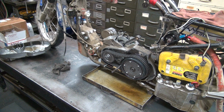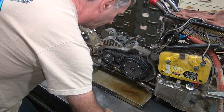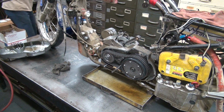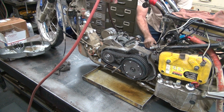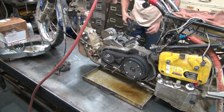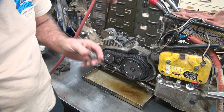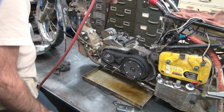So I started using a lock tab just enough so it won't unscrew. There's probably so many times it's loose in there. Alright, so 1.25 inches. Get the big tools out. So they're not very tight. I learned a long time ago, if you tighten them real tight, you can't change the sprocket of the track very easily. So you leave them just enough to hold them. No extra.